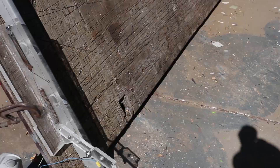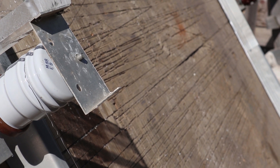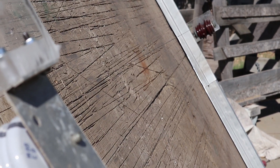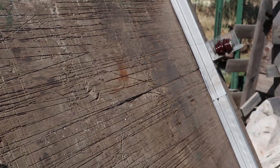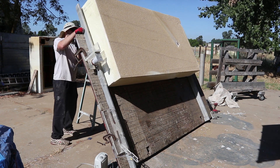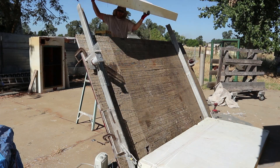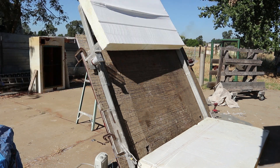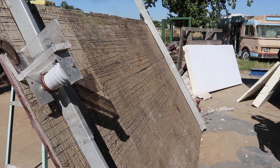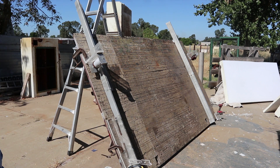The spring pulled the wire when it heated up and then I turned it off and the spring went back. The wire has a lot of waves in it even though I heated it up and let it cool off twice. But after putting the foam block on it — which insulates the wire and lets it heat up more — the wire stretched a few more inches and got quite flat. Not like a brand new wire, but flat enough for me. I had to readjust the tension because it stretched and got flatter.